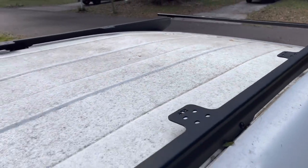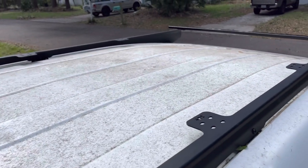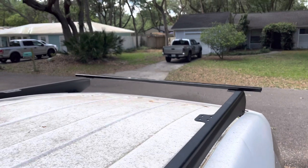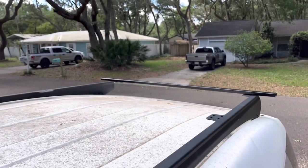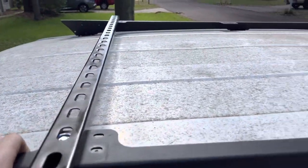I've got two more spots here for bars, and I'll probably buy another 10-foot section and cut it in half. I did 50-inch rails because I need 48 inches wide for the plywood and drywall.